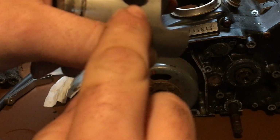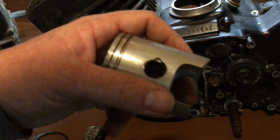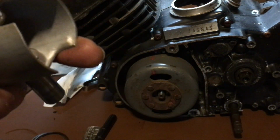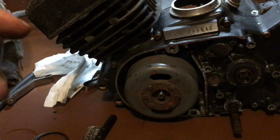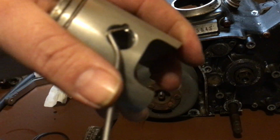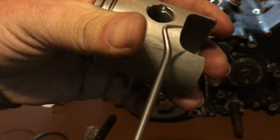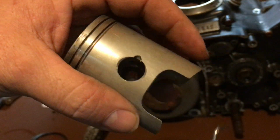Okay, these clips. Now they said that when they did it, they put a burr on the side of your piston. And that can happen. Often or not, it doesn't, but it can happen. When I'm removing a piston clip, the C-clip that goes inside here and holds it, it's got the ring like that with the little clip. I don't want to pry against the piston.